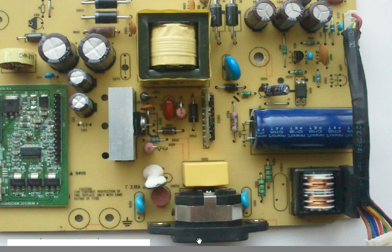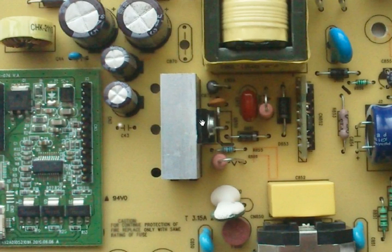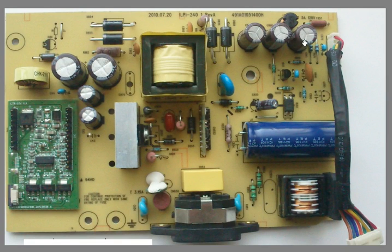In terms of where to look for faults: first, check the fuse. I also do a continuity check from the positive pin through to one of the center pins of the bridge rectifier, and the negative pin to the other center pin — this catches failures in the induction coil or fuse. Then I plug it in briefly, unplug it, and check for voltage across the main capacitor; no voltage means there's an open somewhere. The power MOSFET is under a lot of stress and can frequently fail, so with power off and the capacitor discharged, check if it's shorted. Also check the electrolytic capacitors.